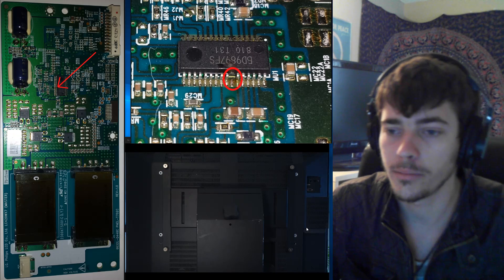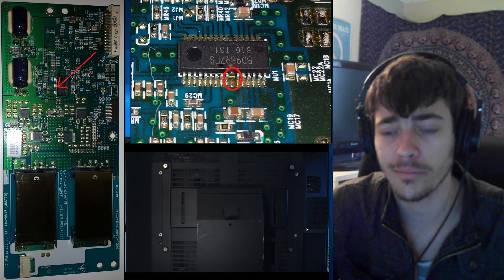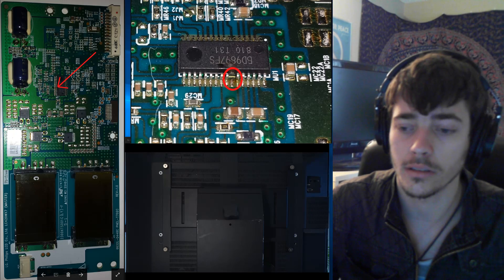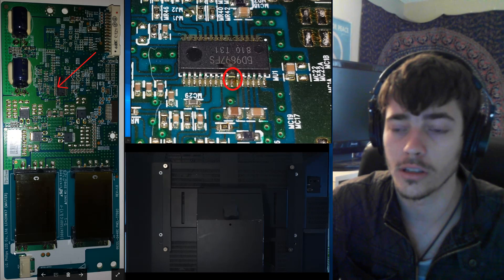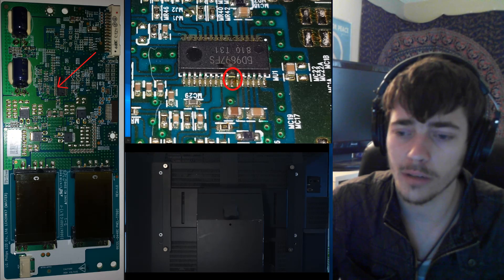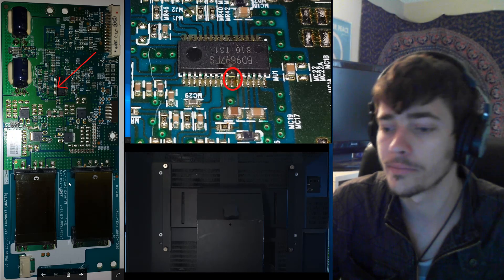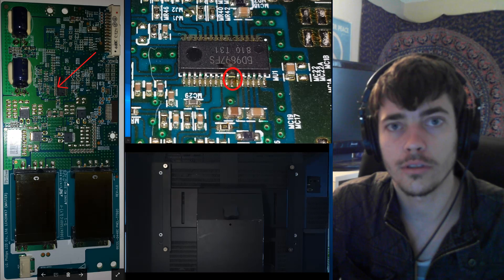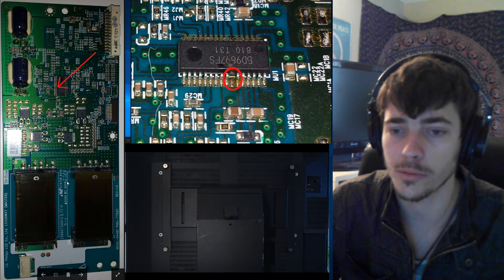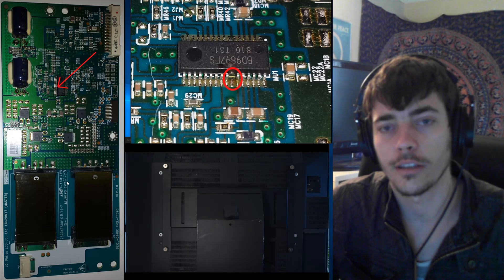This fix is primarily for Philips TVs, but it's likely that if you have another manufacturer's TV this will still solve the problem — it might not be quite the same board, but if you have sound coming out of your TV but no picture, and assuming your TV didn't drop on the floor, it's probably just your backlight board with a burnt out pin and you just need to replace that one little board. If this video has been helpful, please like it and share it, and if you have any suggestions please leave a comment below. Thanks for watching, bye bye.